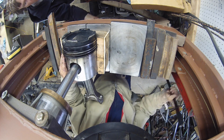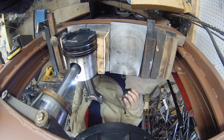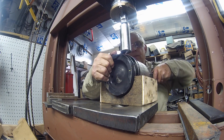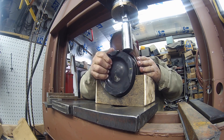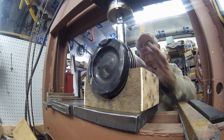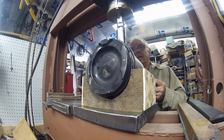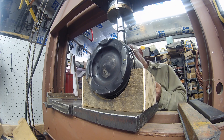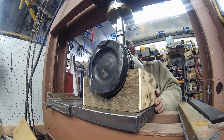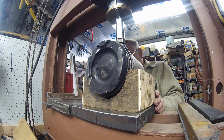We froze the wrist pins. We'll try putting them in frozen, and if needed we have a jig to push them the last little bit. The engine kit comes with pistons but not rods — you reuse yours. Dad machined up a wooden plate from some 2x4s he bandsawed, with a hole for the wrist pin, and he just pushed them out with the press. As it turned out, we found a way to make them drop in using science.